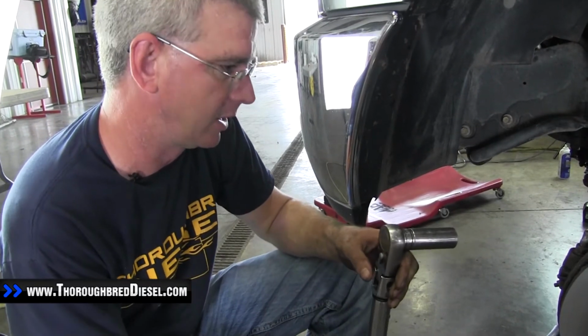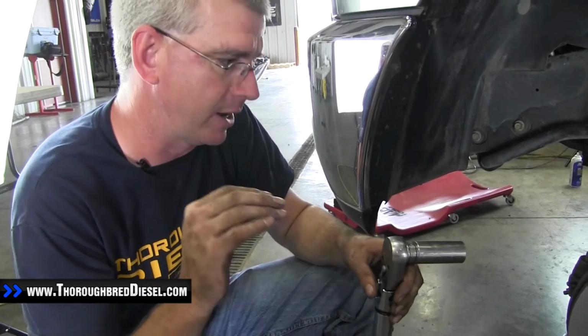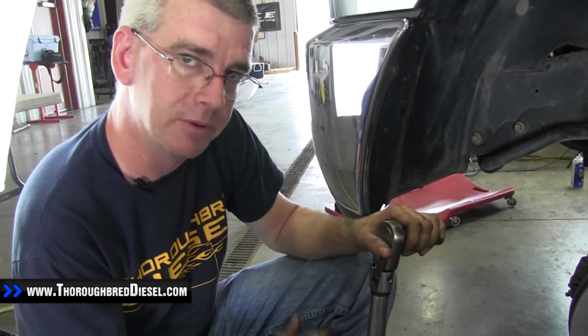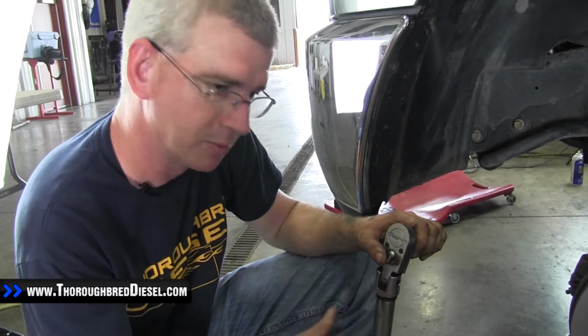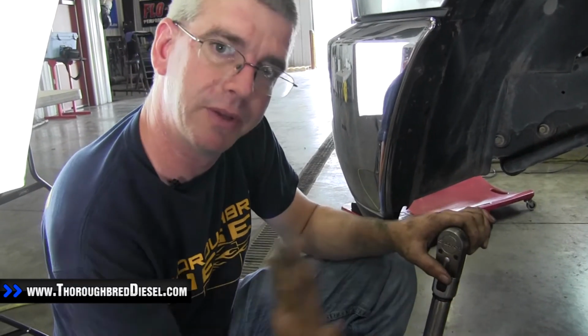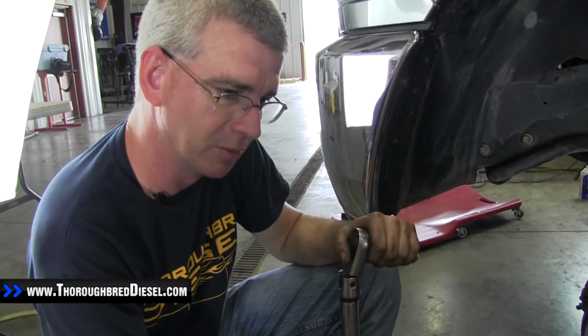on this 2010 Dodge. After installation, you want to have the truck aligned for sure. The alignment will be a lot simpler with the adjustable track bar. With the adjustment sleeve, all you have to do is back the jam nuts off, and then you can make the adjustment of the axle with the adjustment sleeve. So we're going to tighten up this other side. This is going to complete our installation.